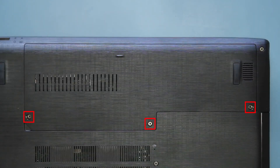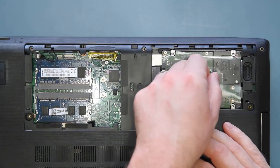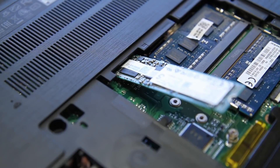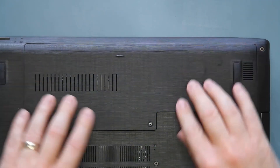If you're comfortable opening the back of the laptop — and it's not very difficult, there are about half a dozen screws to unscrew — that gives you access to the back. You don't need to solder anything or do anything complicated. Just unscrew the back and you have access to the SSD slot and the memory slots, where you can go and upgrade these components. I'll throw a link in the description for compatible SSDs and memory modules. It's kind of like adult Lego — these components just fit nicely into a slot with no wires or soldering required.